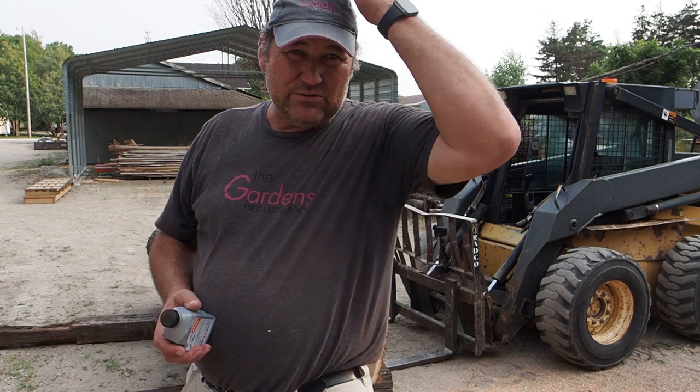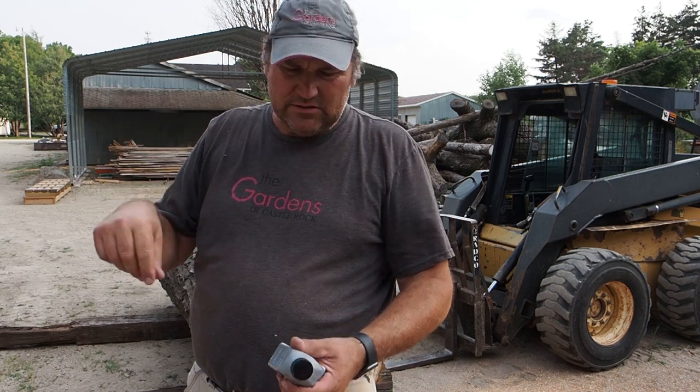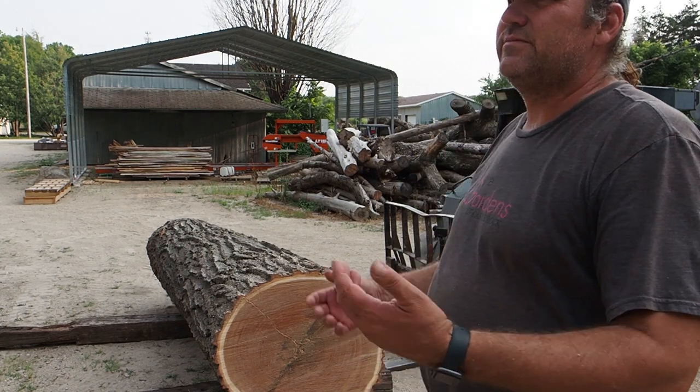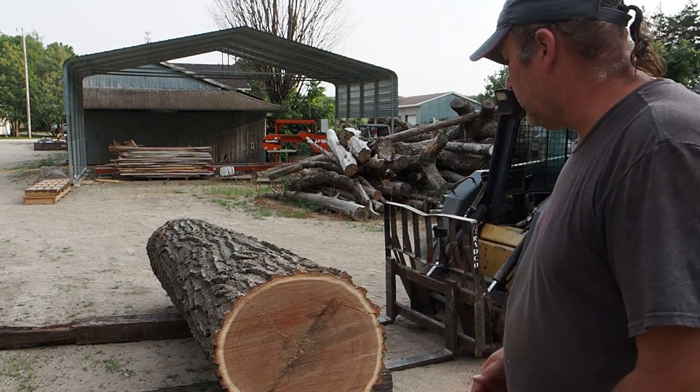And then what I do is drain these into another little container and probably add another 2 or 3 ounces into the mix. So I'm running just a titch rich during this break-in. Don't want to run too rich because I've heard that you're going to get too much carbon buildup. Again, if you know something, leave me a comment down below.